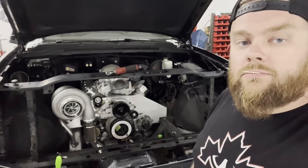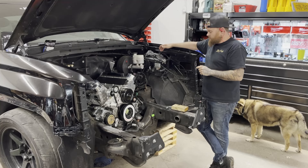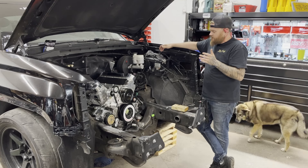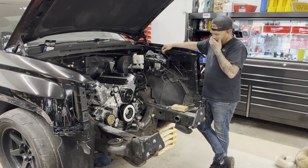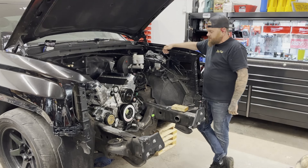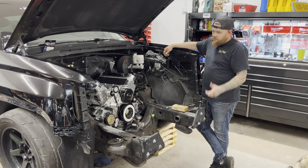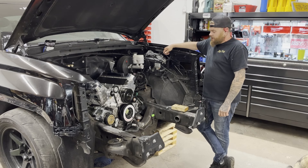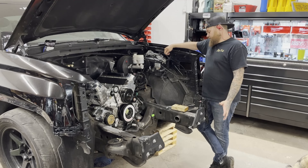The mid plate is still there, the front motor plate is gone, and the motor mounts are in. I've had these Atomic Fab motor mounts for four years — we put together a bolt-in LS/LT swap mount forever ago. If you want to swap your truck, technically it bolts in. Got the accessories back on, put the belt on, and everything fits a lot better.